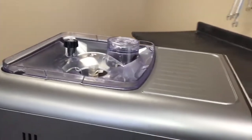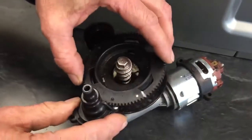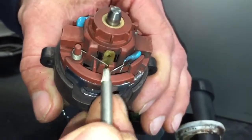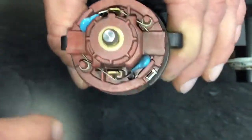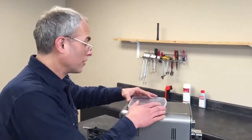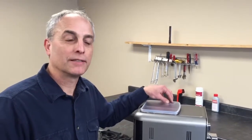And that really is all there is to it. Quick review: when putting the burr in, remember the white line position. If the grinder is not operating, check these little spring wires — you can hear it clicking; make sure they're in place and contacting those tabs. If they're broken or burnt, you need to replace them. If you have a problem where the grinder is operating but not brewing, it might be clogged — oily beans or flavored beans like vanilla can cause this. We always recommend not using oily beans; a lighter roast is preferred.